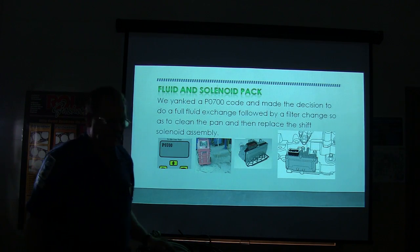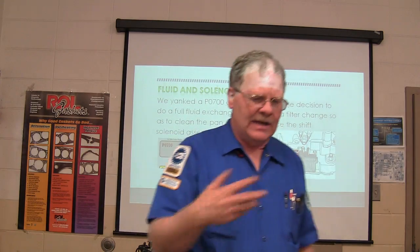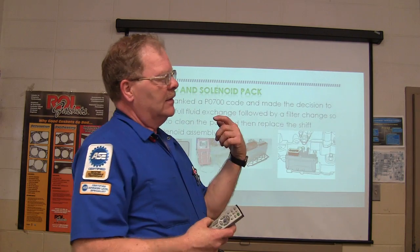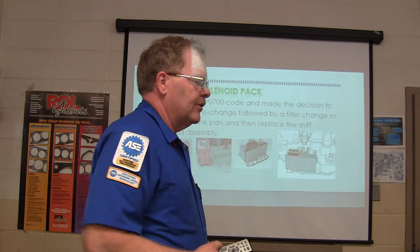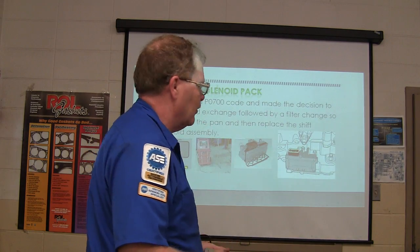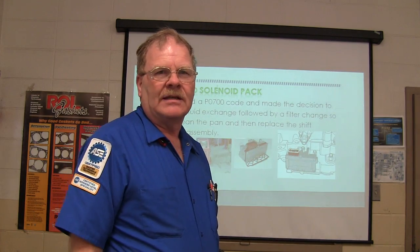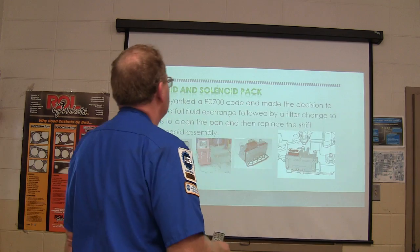And that's what I told the lady. Well, it's actually a guy that drove it, and he passed away later. Anyway, I told him, what we're going to do is a full fluid exchange and filter and all, and we're going to put a solenoid pack on it. We're going to let you drive it like that and just see what happens. I said, this is a gamble anyway, but if we have to put a transmission in it, we'll put a transmission in it, but whatever.